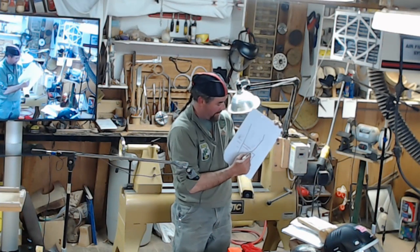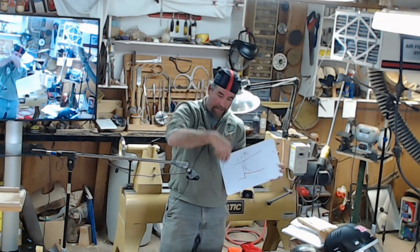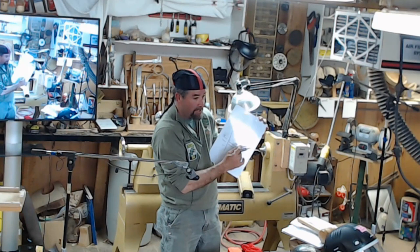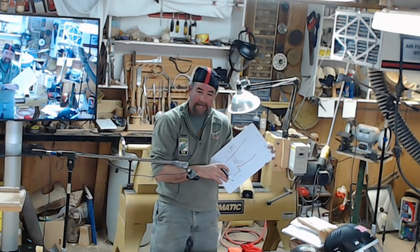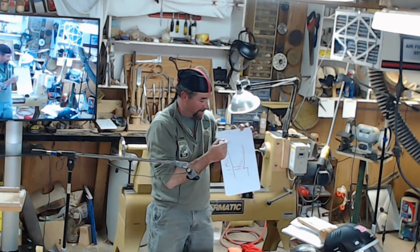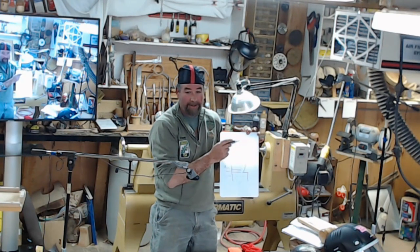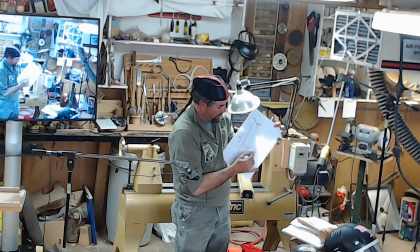So you still have that. The reason for the notch is there's still weight coming straight down on that tree, and you've opened up this notch. So now that tree is no longer there to support that weight. So the tree naturally wants to lean into that notch, especially a straight up and down tree. Now granted, if this tree is leaning backward and you put a notch on that side and you think it's going to go that way, I got news for you. It's not going to go that way. So it gives you a little bit of slop.